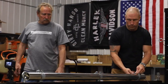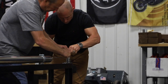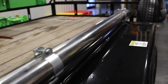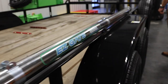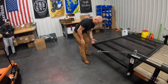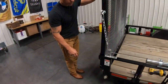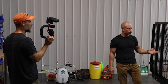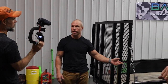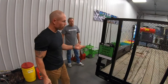My dad actually built this because we were lifting these heavy gates over and over, and when you let them slam to the ground the welds break loose — it's dangerous. The cool part about the Easy Gate is there's other gate-assist systems out there, but with this you only need one, which leaves the other side of your trailer open for other gear. With just a couple fingers you can lift and lower this gate. We've got the adjustable chain linkage here — we can take 85 to 90 percent of the weight off the gate. You could pull a couple links out and get it so light that you could flip it up with your foot.